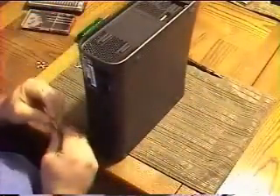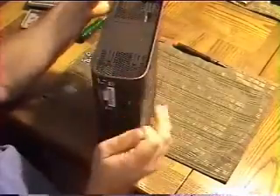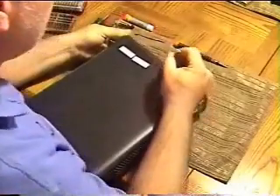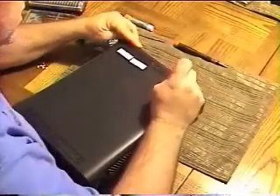The next thing you do is remove these covers. The one where the hard drive is is a little bit trickier. You've got to get a screwdriver in, kind of angle it in from the side, and you'll feel it grab that post on the inside, and then just pull it to the inside and it should pop up and release. With all the others, you just need to look down and hit the post from the inside.